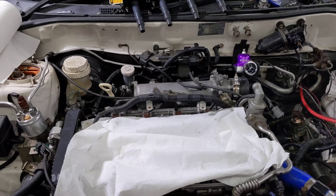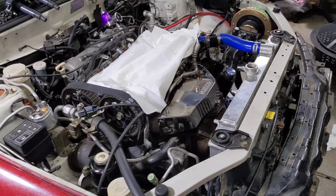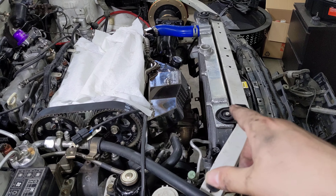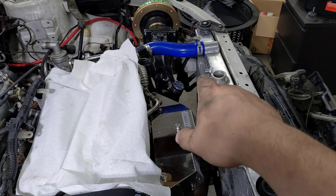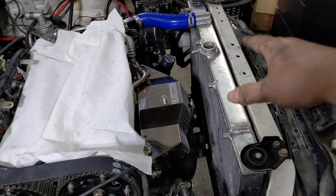Just a quick video. I got a lot done in the last hour and a half that I've been out here. In the last video I talked about the radiator — I got that in. I took the slim fan off and I'm going to try to retrofit a Mirage fan to fit on there. I've been told that either the top or the bottom line up and you've got to make something to fit, but that will be ten times better than that crappy eBay slim fan.